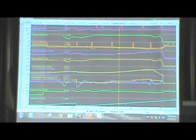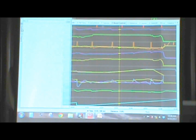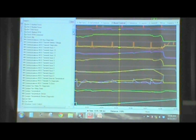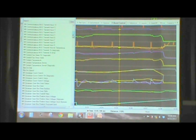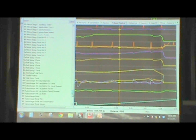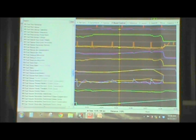This is a turbo pass. I don't really know, it doesn't look like a very good one. But this is our data analysis software. So when you come in, the ECU has data logging in it. You pull the data out of it, and you bring up our channels list. Currently, this is a development kit, so we're logging 350 some odd channels. Just scroll down through the list. These are all of the different channels that the ECU is currently logging every single pass. So you can get a really good idea of exactly what's going on in every category.